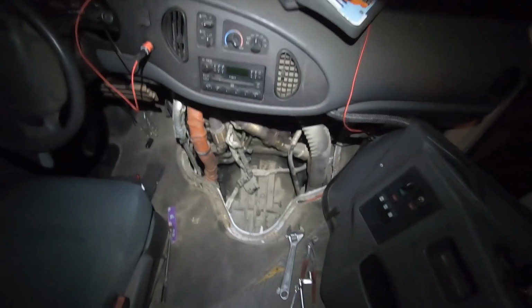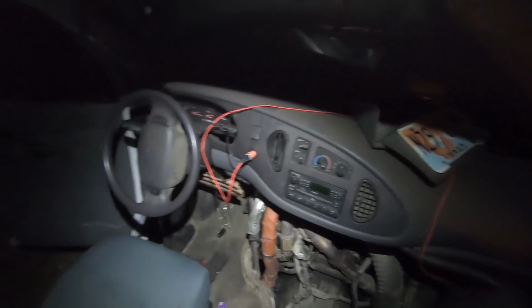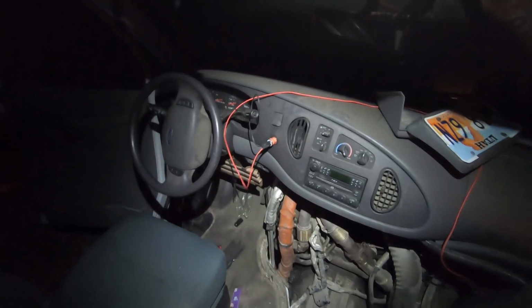All right, 20 minutes later, everything's back together, and I'm a little nervous to see if this will turn on. So I'm going to prime it 3 times once I open that fuel system and see if something happens. I'll check for smoke in the exhaust, see if there's a little bit more than earlier. There was just a little bit coming out. And then I'll hook the scanner up if I need to and see what kind of details we're getting. There's that fire keeping me warm when I go over there. See if we're getting any sort of difference if it doesn't start. So fingers crossed that it does start right now though.